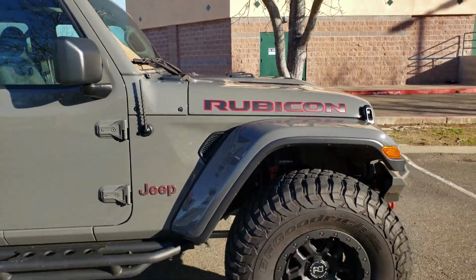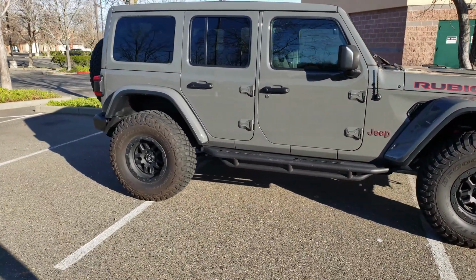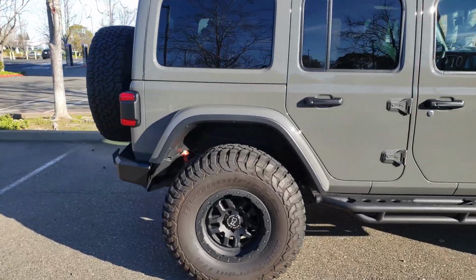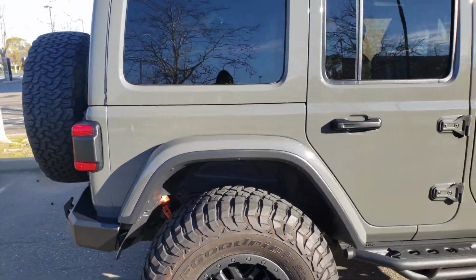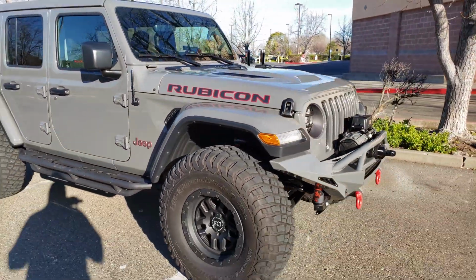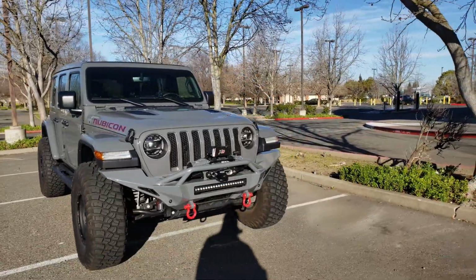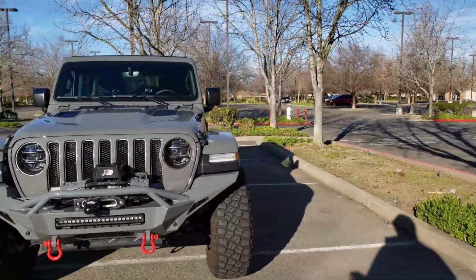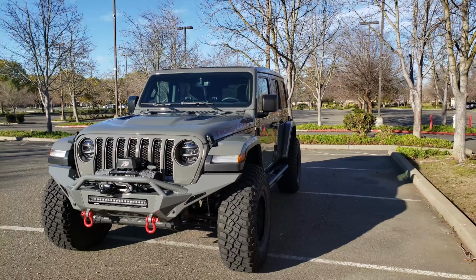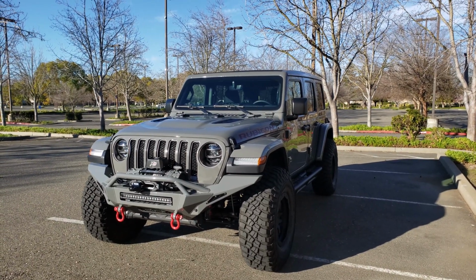So what I did midway from 3,000 miles, now it has 10,000 miles, so between those several thousand miles, I did upgrade the suspension a little bit. So I added the matching rear shock as well as a Rubicon Express lift system, which is also 2.5 inches of lift. So I just kind of matched the setup. I don't like running spacers, so I ran that for 7,000 miles, and it did great on trails and SVRA runs and camping trips and things like that.